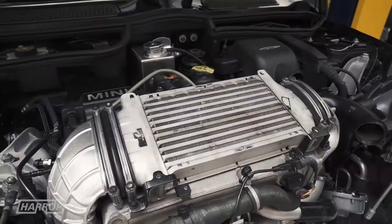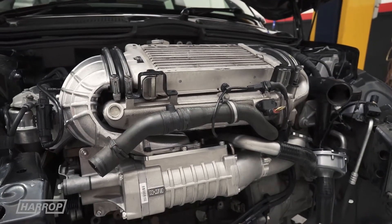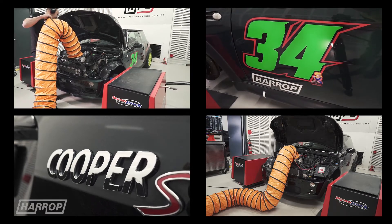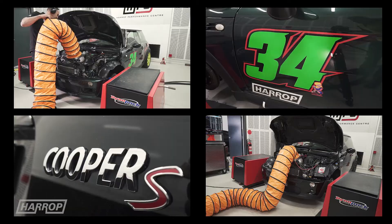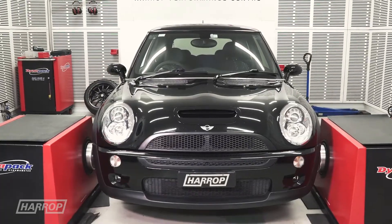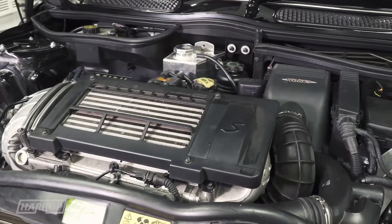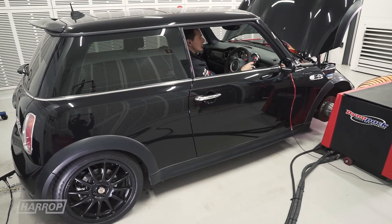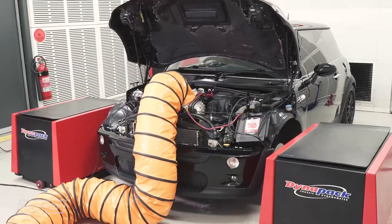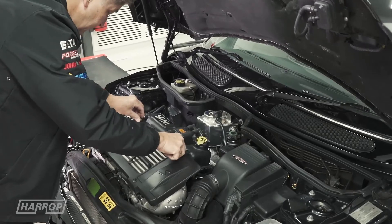The system is designed to suit stock and aftermarket top mount intercoolers. With many variations of powertrain upgrades adopted by Cooper S enthusiasts, we tested our TVS900 kit on two different cars for comparison to the factory M45 supercharger. This clean 2004 black Cooper S is a well maintained street car that arrived with a stock M45 blower, 15% overdriven, showing 16.7 PSI of boost, with the JCW intake and a cat-back exhaust, producing 158 horsepower at the hubs at 6700 RPM and 152 foot-pounds of torque at 3750 RPM.